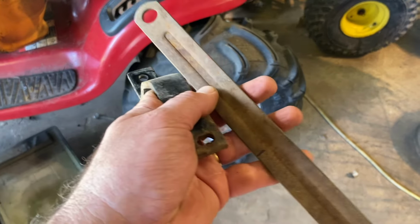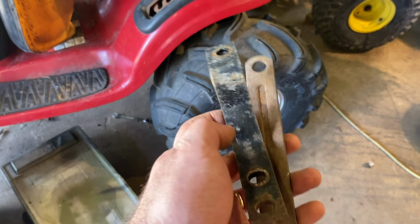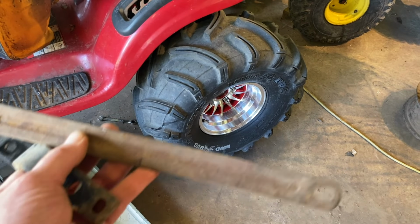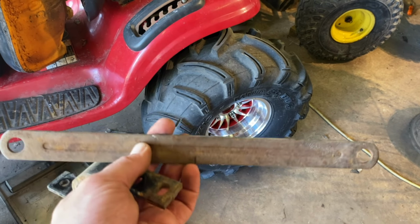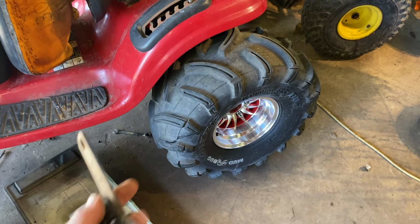Anyway, I'm working on the brackets for the transmission. I've got two of these. One's bolted on underneath there. I need a 6-inch piece to extend it. If I cut this in half, it makes two 6-and-a-quarter pieces. So I'm gonna cut that in half, weld it to these, then that part will be done.